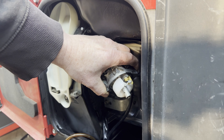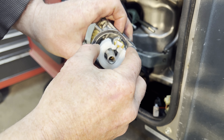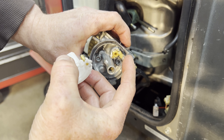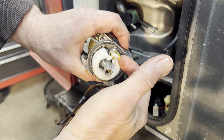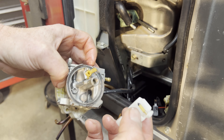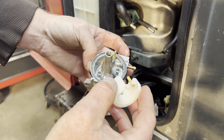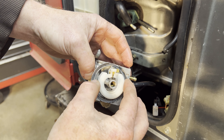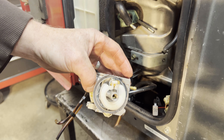All right, here we have the float and the needle — see it right there, that sits right in there. This plastic piece right here — there should be two sides to that post because there's a pin that goes through here, and you can see that it is gone. Somebody has been in here, somebody broke it, somebody put it back together. Without that piece, this needle is not going to sit right; gas is just going to keep filling the bowl and do exactly what we saw.